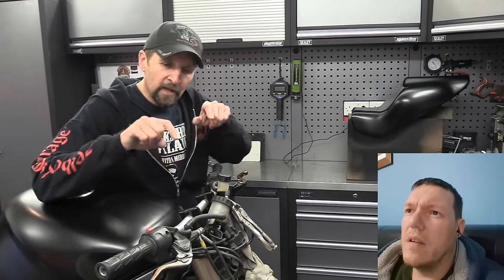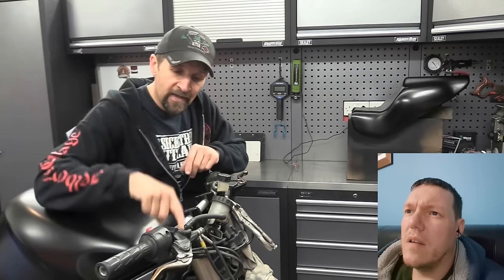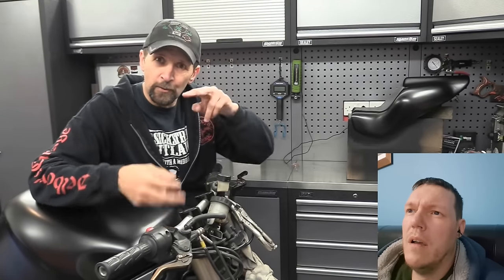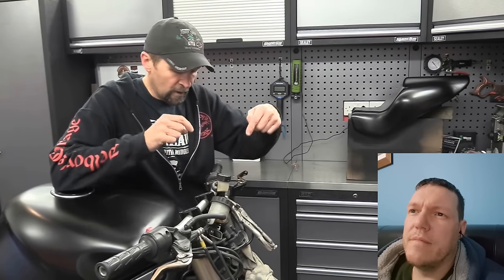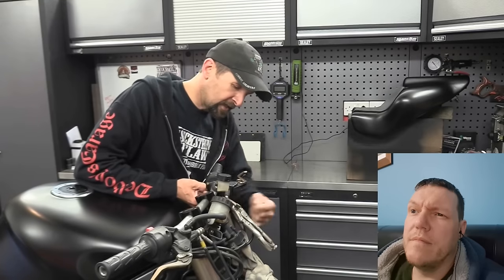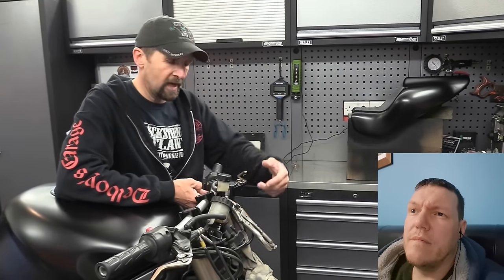The two new master cylinders, I'm going to fit the brake and clutch. They have switches, obviously, in the new ones, the two tangs that stick out to put the wiring plugs on. That side will fit straight on because the loom gives me two plugs to put on. This side is not, it's a solid plug. So I'm going to snip that off, rewire the loom out here, take some of that wiring out. So there's a little bit of messing around to do with that so I can plug it in.